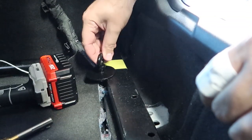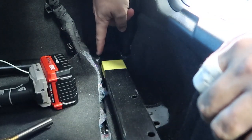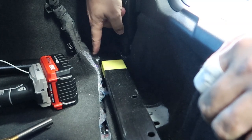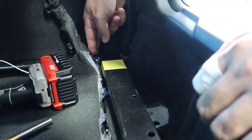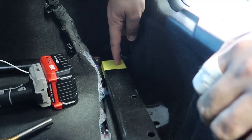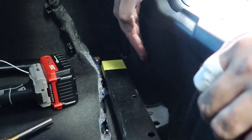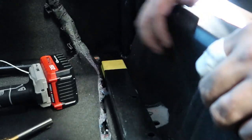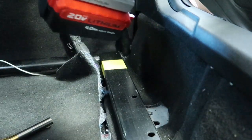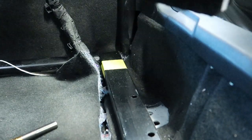I'm going to set this bolt right on here, reach underneath and thread it into the bar. As you can see this is mounted to — or welded to — the actual roll cage bar. I marked exactly where I want it based upon where the seat sits, so I can wrap that strap around into the seat and bolt it to the ground. Since I have that already marked, I'm going to go ahead and put my pilot bit in and drill the hole.